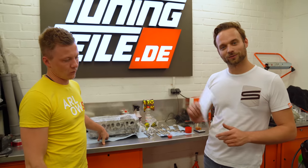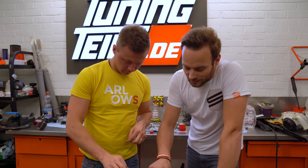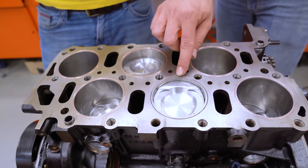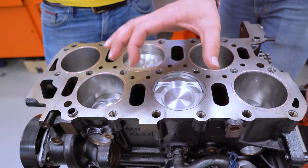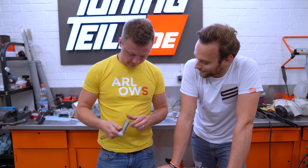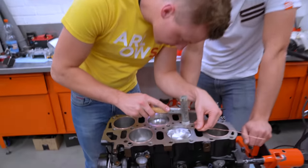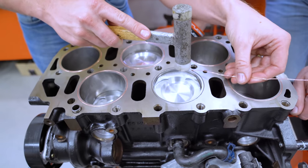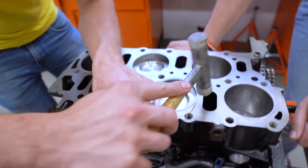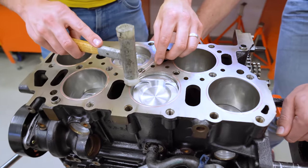That's why we're doing this live right now - we'll put the head on and do the same measurement again through the spark plug hole, then we'll know exactly. And then we'll put in 1mm longer connecting rods and disassemble everything because the compression is too low. No, okay. While Marius is building the head on, let me think about this. We can show you what we changed on the engine over the winter. Björn installed these nice rings here. We also just measured the cylinder where there was no ring yet, because this ring has a slight protrusion.